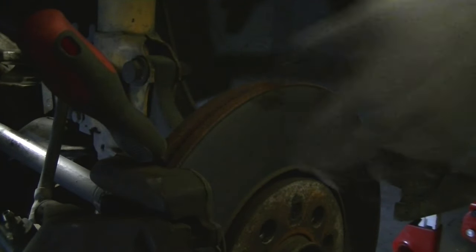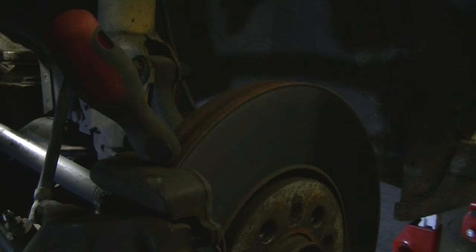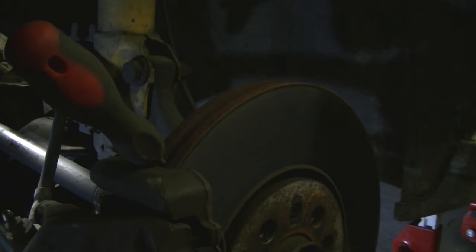There's not a lot of room to film in here so I'll just tell you how I do this. The car's in neutral so we can rotate the axle around. What we do is get our triple square bit, jam it in, and then to stop the axle from being able to rotate, put a screwdriver in between the two halves of the brake disc — it gets locked against that channel so it can only turn so far and it's locked. That saves you getting in and out of the car putting it in park. Undo one bolt, rotate it around to the next one, lock it off, and get them all undone. That's the quickest way I've found to do it. I can't really film in there so I'll just get them undone — take my word for it — and then we'll get all this out of the way.